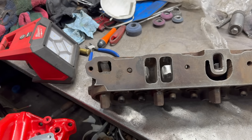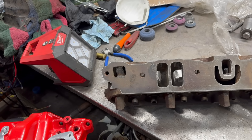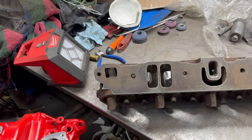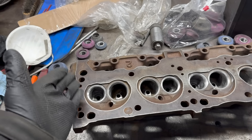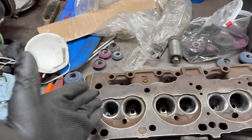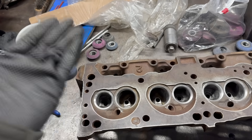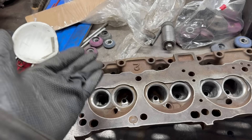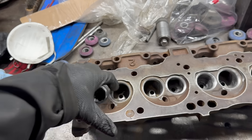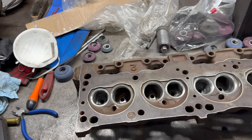Multiple people asked me in the comments on the cylinder head video if I have a porting template for these heads. No, I'm just winging it. I'm not removing a ton of material except right here — that got skinned up a good bit — so there's pretty much no risk of getting into water. People asked how I could possibly know that this would work, or how much power I would get, or what kind of CFM would flow through these ports when I'm done. I'm not doing anything radical here. This is just basic cleanup; it's tried and true, been done gazillions of times. Street engine. The big takeaway is: don't remove too much material, don't get crazy enlarging the ports. Just clean things up, knock sharp edges down, blend the valve seat into the throat — that's terrible from the factory, and it's so easy to just clean that stuff up.